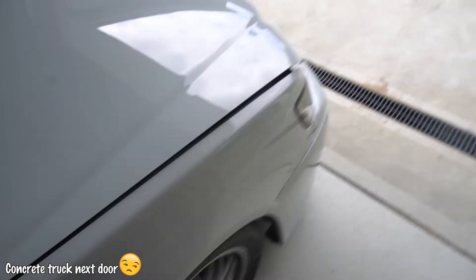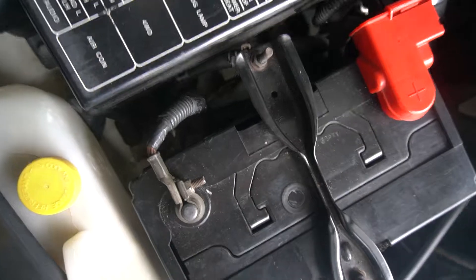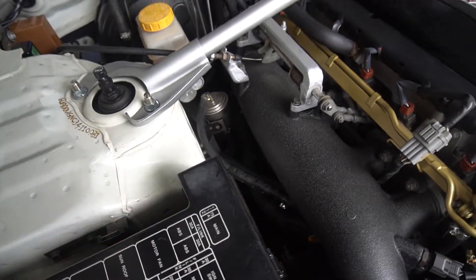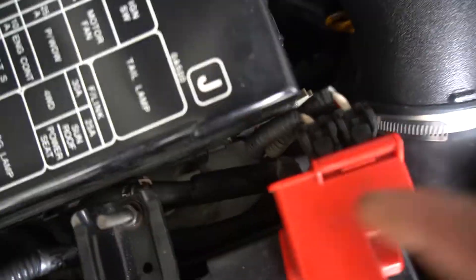Have a look under here. It's still so clean. They decided to put their boost control solenoid down there, jammed in by the battery and the fuse box. I think 32s are on the strut tower, I think 33s and 34s are somewhere similar. But I've got it on good authority that that line there is the one with the restrictor in it. We're going to rip that out and have a look in there. That one there goes down and then actually under the plenum, around the back, and then that feeds the turbos. Have a look inside there and rip out this little olive, they call it.